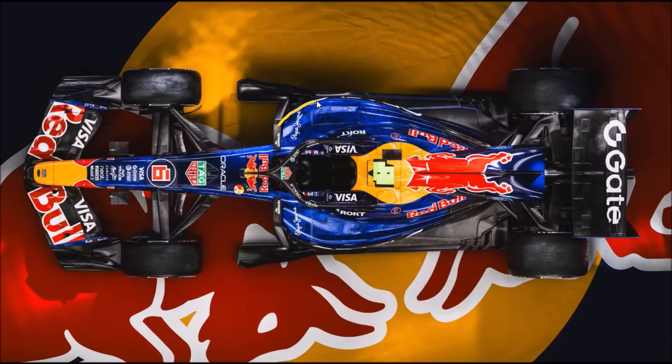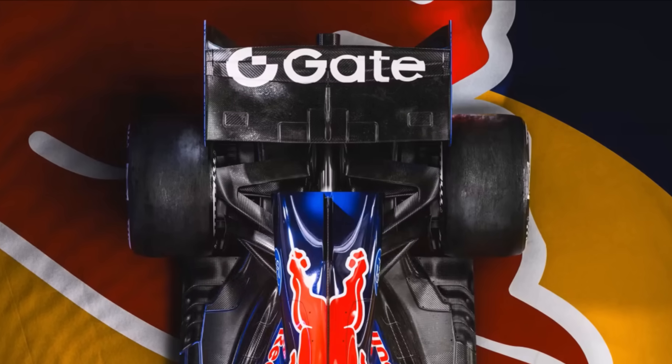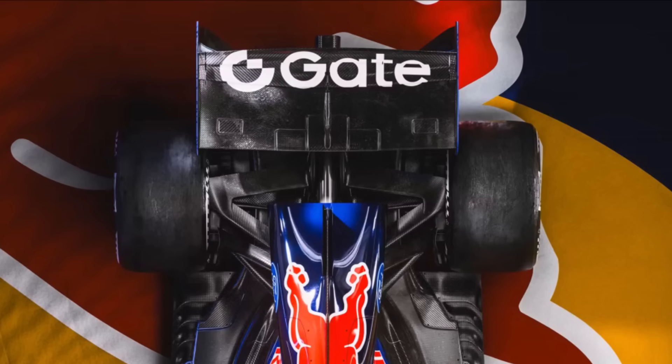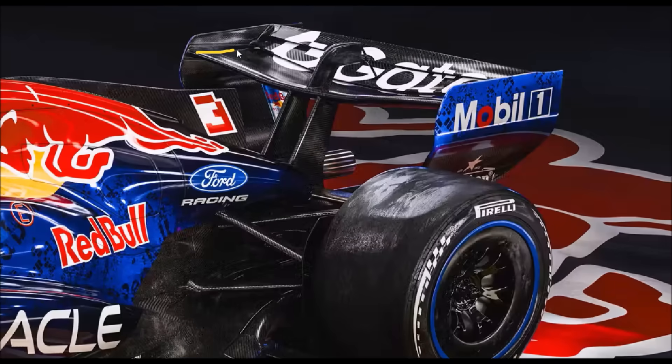In top view we can basically see three parts of the bodywork: the side pods, the center part with fuel tank and engine, and what we can call the outlet trumpet — a structure which grows from the middle and positions all cooling losses underneath the rear wing. As we described in my rear wing design video, teams will try to load the two rearward flaps more to lose this downforce and hence drag when the wing is open. On the Red Bull we see exactly that: a relatively flat first element and cranked-up flaps which will be flat on the straights.